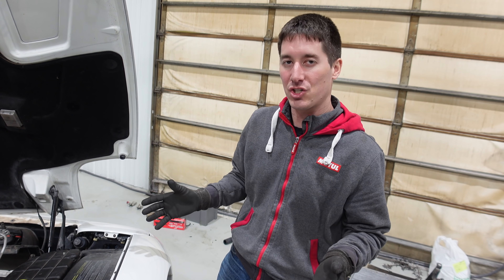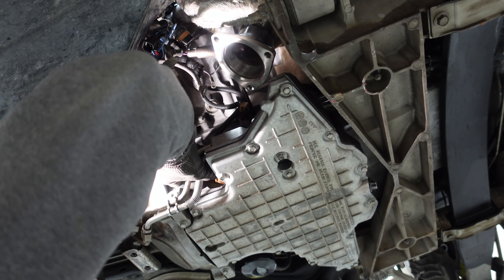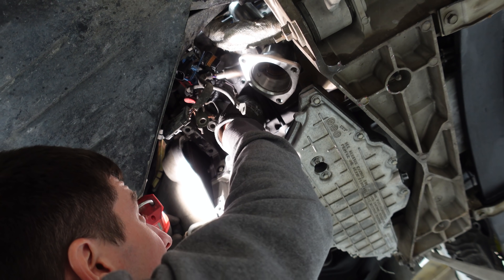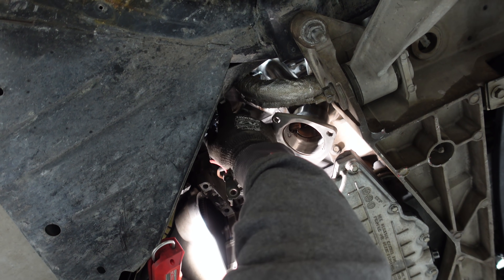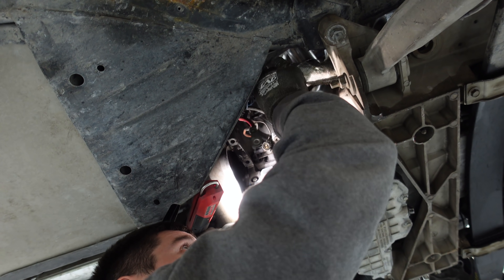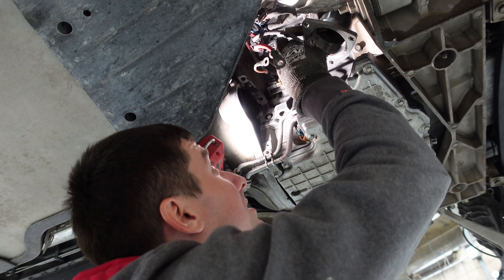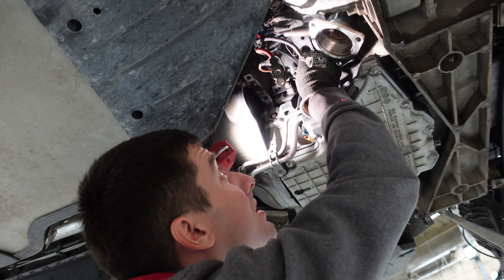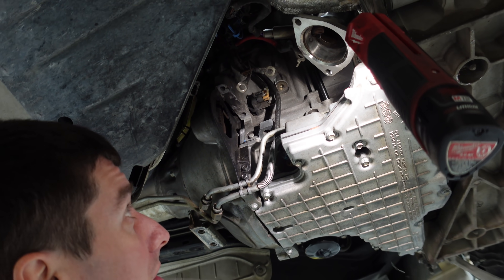The rest of today — we have all the Z06 shocks in and the back of the car all put together. We're going to lift this thing up and finish wiring everything we can underneath it, get the starter back in here. Plug in everything in here — this is our oil pan sender there, and crank position is going to sneak up in here. These things are all just kind of falling right back into place. We've got this O2 sensor that plugs in right here. Basically just plug in all the connectors — they all just match up. The three pins go to the three pins, four pins go to the four pins. You'll figure it out. There's a bunch of grounds. This is power to the starter. This is a chassis ground. There's another block ground that's got to get hooked up there.